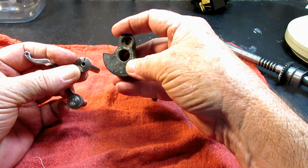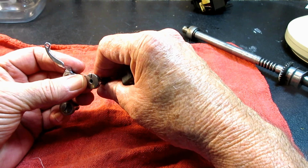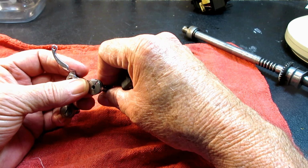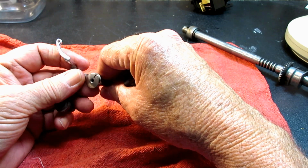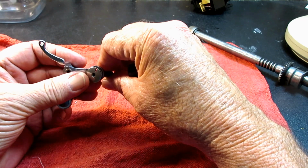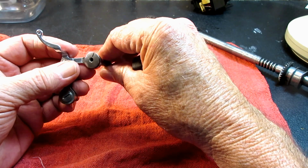And the other thing about the check spring, a lot of people felt it was the check spring, and there wasn't any problem with the tension unit not putting tension, or the disc being wrong, or the thread not being between the discs. I've done a lot of tension units, and I replaced the whole tension unit, and I replaced just some of the parts of the tension unit, but I always had plenty of tension on that tension unit. That's what got me involved with changing the bobbin tension, bobbin holder tension, which didn't help.